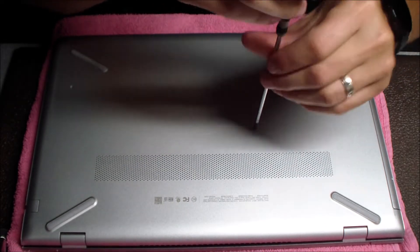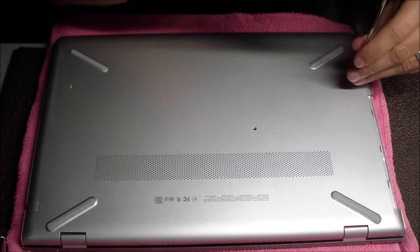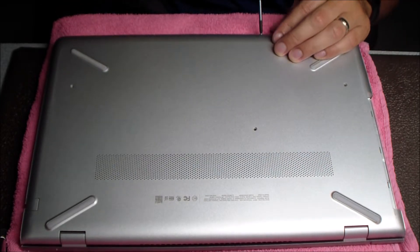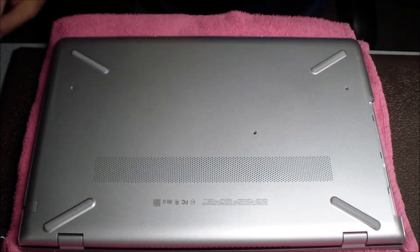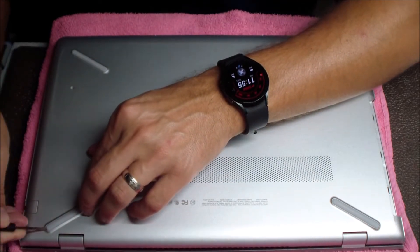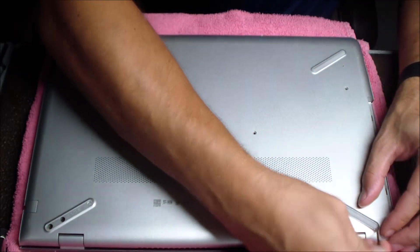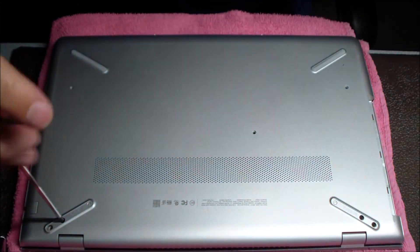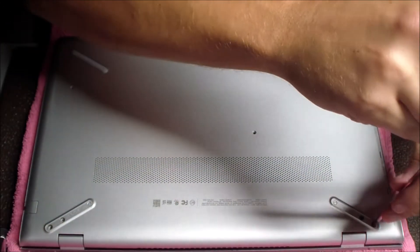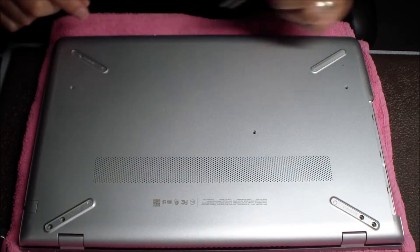This one needs to be internally replaced. With this HP-15, you want to remove the bottom screws. One of those bottom screws holds the optical drive into place, which also needs to be taken out. Then you can remove the other visible bottom screws. The next set of screws needs to be removed from under the little rubber stoppers — the top set is what's holding the hinge in place. There's also another set of screws under the rubber stopper that are a little bit smaller, and these need to be removed too.